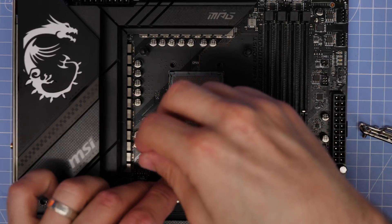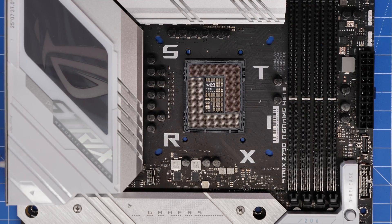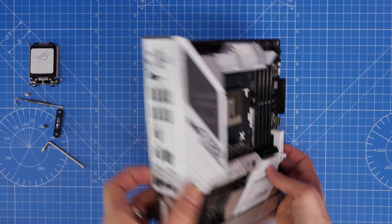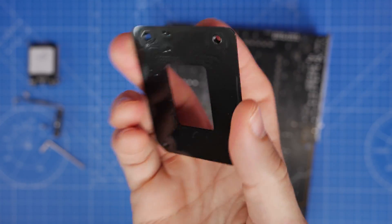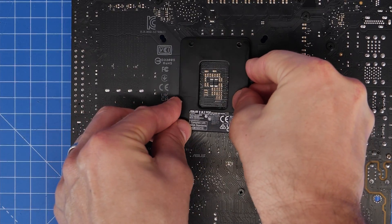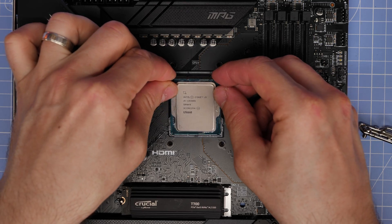This is why I recommend removing your motherboard from your system — because around the CPU, you can see those four screw holes we just removed, and there's actually a bracket at the back. To demo this, here's another motherboard. I recommend laying the motherboard on a flat surface while doing this, because as you see if we flip it over, that back plate has come off entirely — there's nothing to secure it to the back apart from the screws that run through that bracketing, which means it's now loose. If you've done this while it's installed in your case, it could potentially have fallen somewhere in the back, could get lost, and could damage some of the bits on the back of the motherboard. So it's much easier to do this on a flat surface.